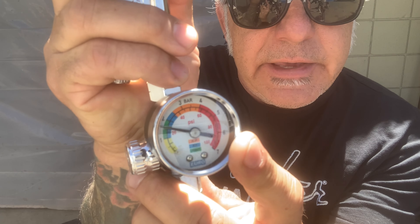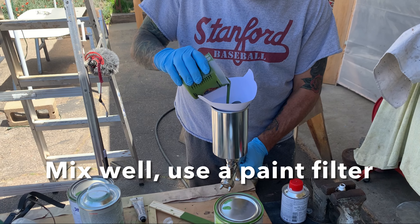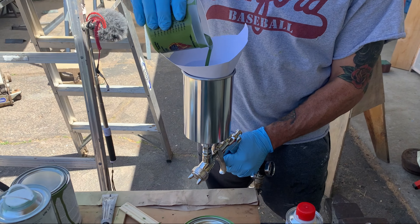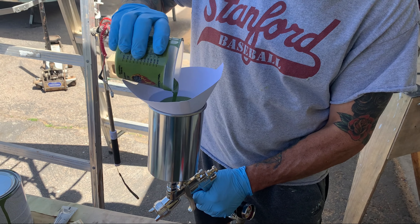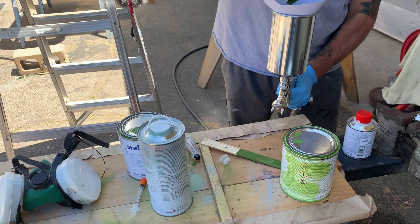It's kind of gnarly stuff — if I put primer through here and didn't clean this thing properly, I'd completely ruin it. The tip is too small and they don't recommend primer going in this. The nice thing about this gun is you can buy parts for it and have it rebuilt. I put a gauge on here so I never get more than 20 PSI — can't hurt the gun. Here's how you adjust the air right here. So we're going to go ahead and mix them up and shoot our rims.